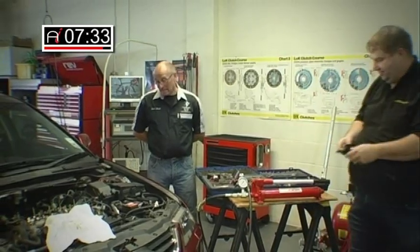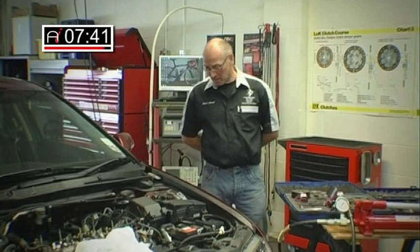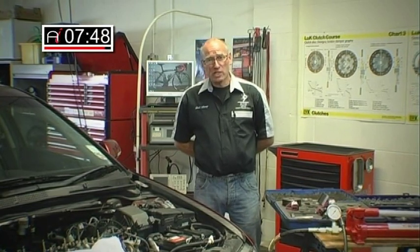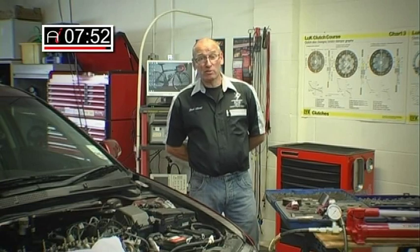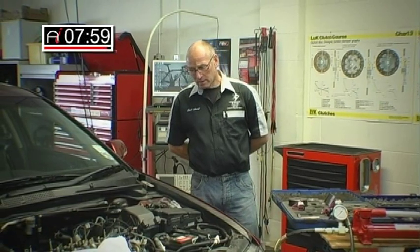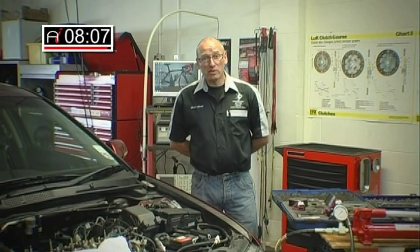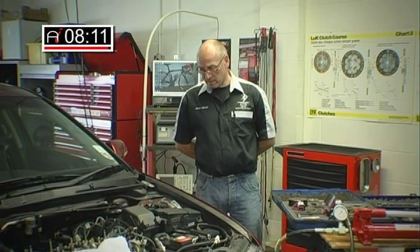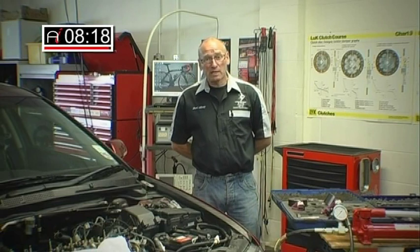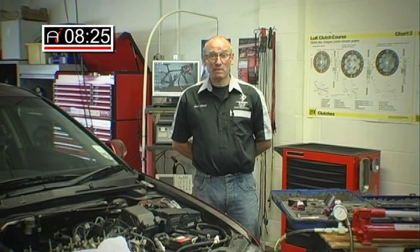There you go, Frank. Thank you, Tony. From our point of view, this decision should have been made a little earlier. The lesson to be learned from watching this process for the first time is that when these injectors are obviously tight, you have a choice: you can invest in the tools, but they're expensive and require specialist knowledge to apply. Often, even for us as specialists, we would not consider buying this tool because the opportunity of using it would not justify the cost. With Tony's expertise on hand, this type of work is much better subcontracted. We're going to relieve some of the corrosion around the bore, recut the seats, fit four new injectors, and get the vehicle back on the road. My thanks to Tony, and I hope you've enjoyed this month's how-to.